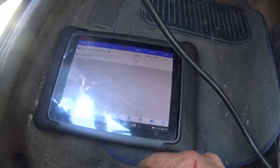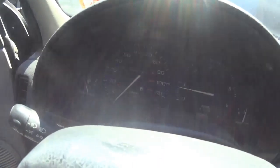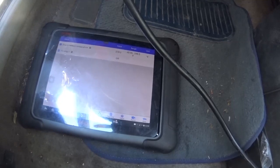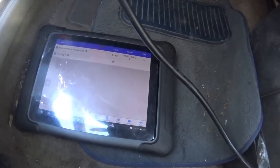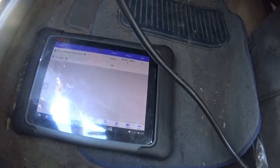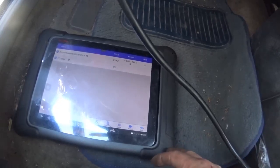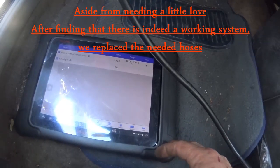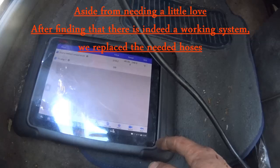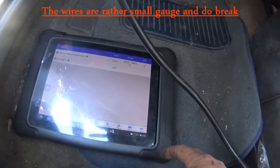The fan circuit is fine. The car needs hoses and other maintenance — it's old and everything is dried out and rotted. It has very low original mileage and apparently wasn't driven much. The cooling temperature sensor may have been faulty; these sensors used to go bad all the time on Saturns. When you replace the sensor on these cars, you change the sensor and the pigtail together every time — you solder in a new pigtail. You'll have a problem if you don't do it that way, as the pigtails always fail. The pins are extremely small and it's a very common failure.